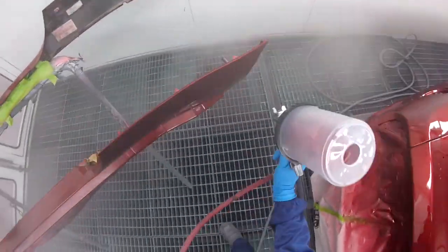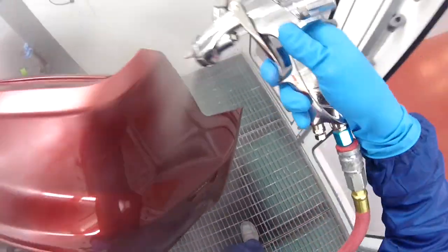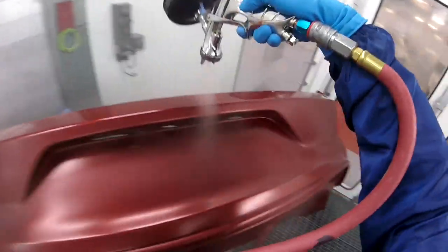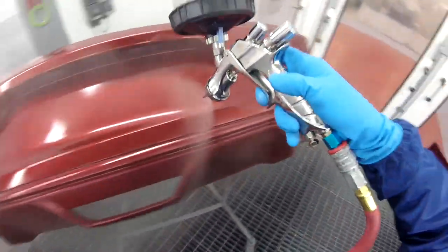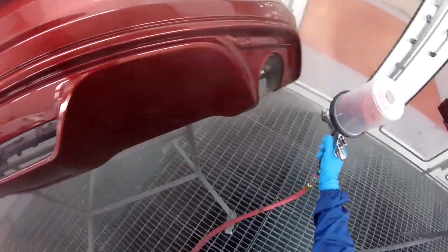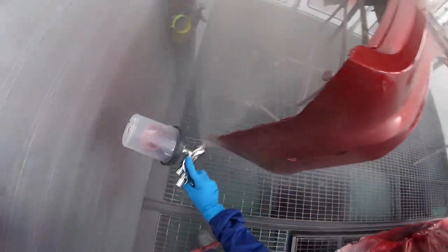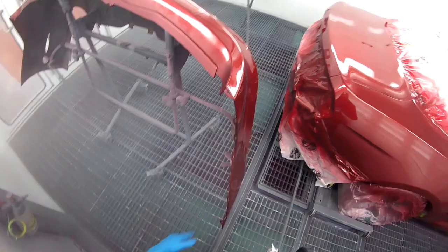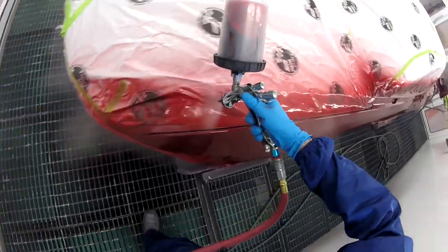Oh my goodness. So yeah, you gotta make sure always that, wow, I said making sure a lot, that you can stay the same distance from the panel, whatever you're painting, because that way you're gonna assure that you're getting everything consistent, and that is the key right there, being consistent. Anything that is consistent is fixable because you've been doing the same thing. So if you're consistent in everything that you do and something goes wrong, you know exactly what you have to do to fix it by going back and seeing, okay, I always do this, I always do that. So you can have a way of fixing it because of your consistency, right? And then if you're consistently screwing up, then you need to do something different, right?